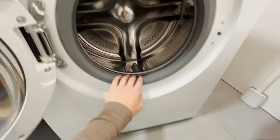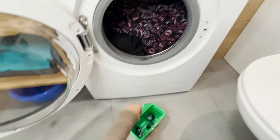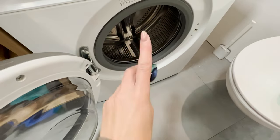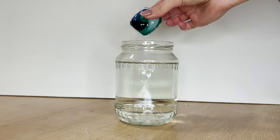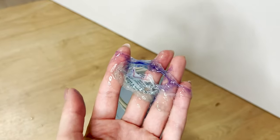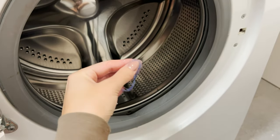Most people use laundry capsules incorrectly, leading to internal damage in washing machines. Improperly used capsules can clog pipes, filters, and even damage clothes. Capsules appeared in stores a few years ago — a portion of laundry detergent is placed in a water-soluble coating, and it is this coating that can cause a huge problem. You can only use them when you set the washing machine to the appropriate temperature, because the capsule doesn't dissolve properly at too low a temperature. Its residue can build up in water drainage pipes, creating sludge responsible for the unpleasant smell from the washing machine.